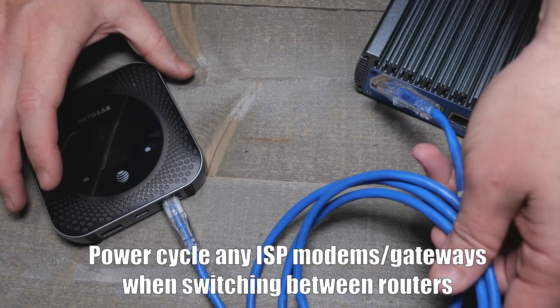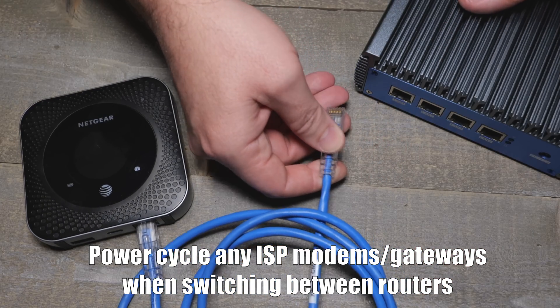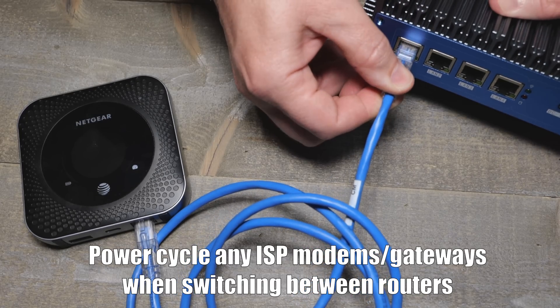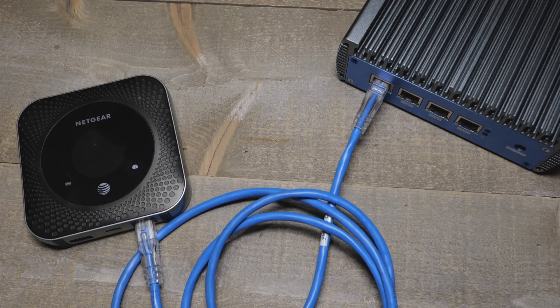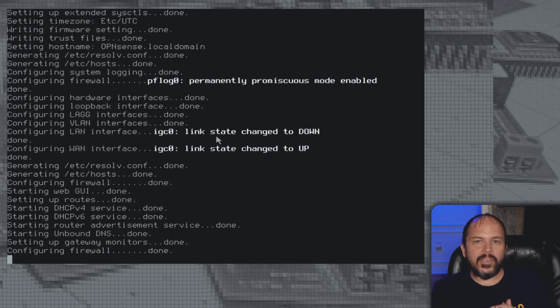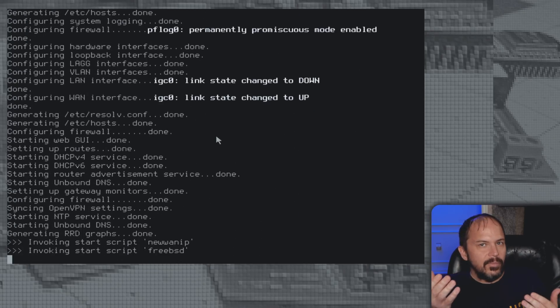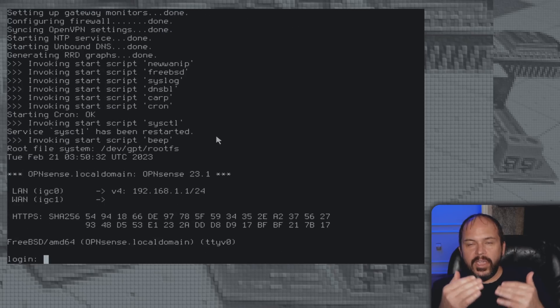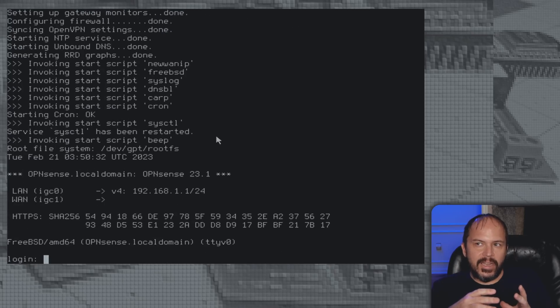I have one cable connected from a hotspot on eth0. If you want to test things without using your exact router — and not everyone has two ISPs — you can plug it into your existing network and just use it as a test. You'll be double NAT, but it will allow you to get familiar with things and put stuff behind it.